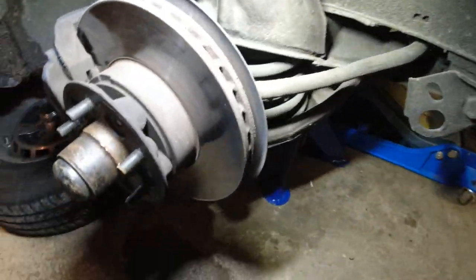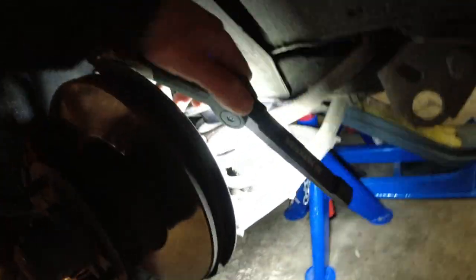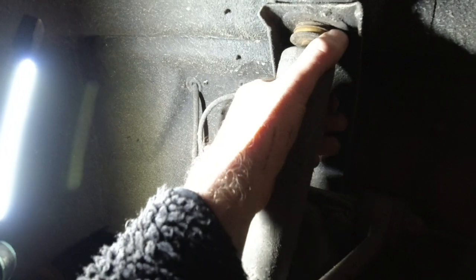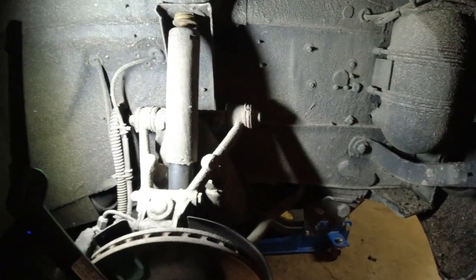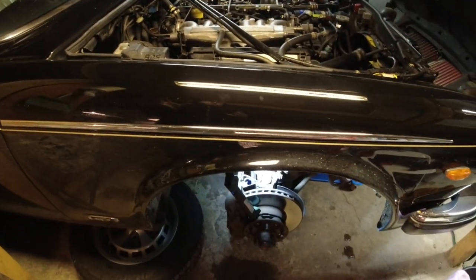Let's see here. Once again it's not broken, but there are some really, really bad cracks right in it. But I think our main issue — let me set a light up for you guys — our main issue is the top shock mount. Right there. That is the knocking sound. So, like the title of this video, we're going to talk about the common front suspension clunks.